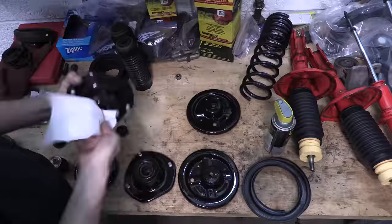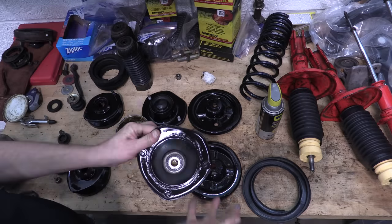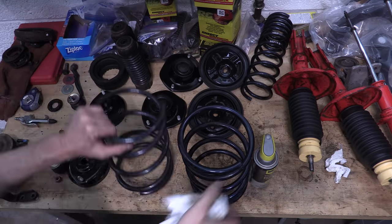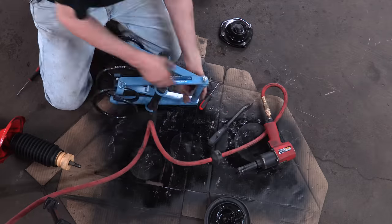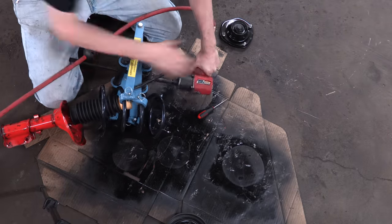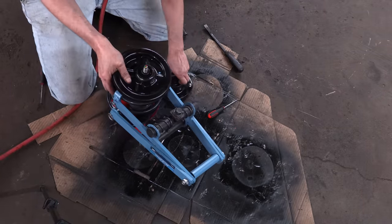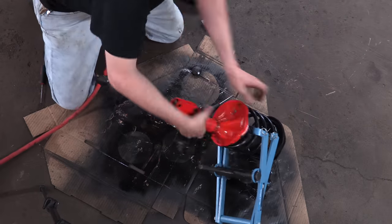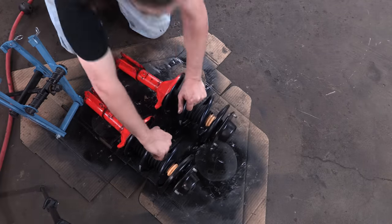Another thing I need is to clean the old grease out of the front strut bearings — it's most likely as old as these parts. Based on its chocolate pudding appearance, I'm sure that's pretty accurate. I'm just replacing it with multi-purpose grease; this doesn't need to be anything fancy, it's only for steering. I also pulled the springs out of the old spare set of Galant struts and might as well buff those up before we start assembling stuff. These are Robert's OTC spring compressors — they're mint, but there aren't very many coils for me to grab onto with these springs. Once you compress it far enough, you can line up the slot on the upper perch, align the big holes on both spring perches, tighten it all down and take the spring compressor loose again.